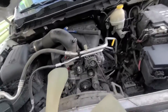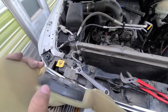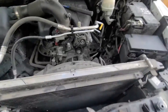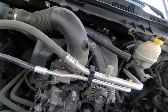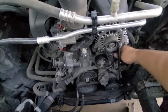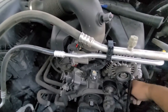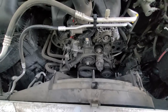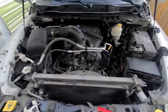I took the fan and the shroud off. In order to take off the fan you have to rotate the nut clockwise. All I did was use a 36 millimeter crescent wrench. The other thing I had to do was bend a piece of steel and stick it behind the belt, up against the tensioner pulley — that gave me enough leverage. The nut wasn't even tight, just a little oomph and it was loose, then I twisted it off by hand.